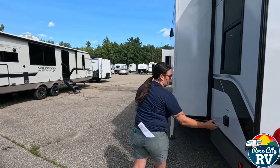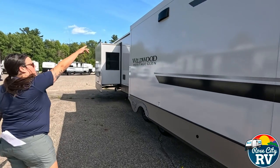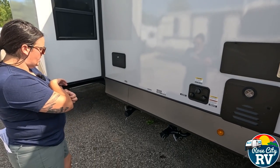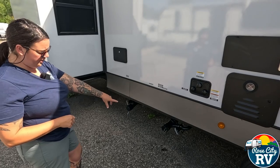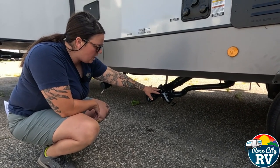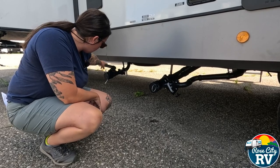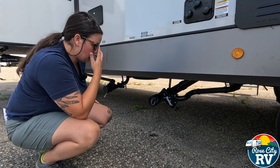In the rear we have our 50-amp hookup, which is a good location since posts are typically at the back of your site. There's a range vent and both sewer ports — the front port serves the bathroom sink/shower and washer/dryer hookup, while the rear port handles the kitchen and toilet. The 3-inch port with the black handle is for the toilet; the 1.5-inch gray is for the kitchen. Having two gray tanks really gives you a lot of capacity if you don't have full hookups.